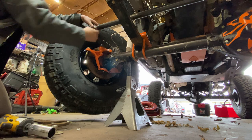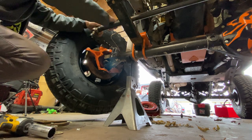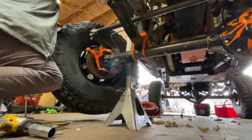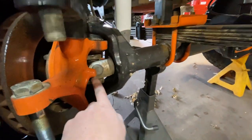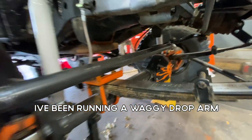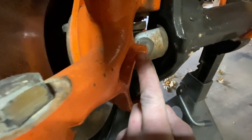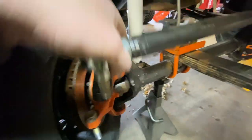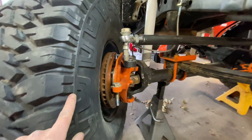That tells you right there that the steering box still has more swing than what this is gonna allow. I can push it over, drop it in, and we'll hit the stops but the steering box won't hit the relief. I ran these in as far as they would go and I still can't max out the steering box before the knuckles hit. So my choices are: go back to the shorter stock pitman arm, which won't give quite as much steering angle, or option B - grind off some of these nubs on the Reed knuckles so it will extend further.